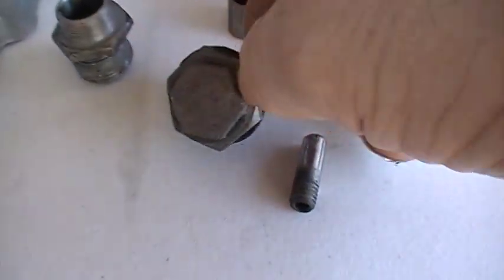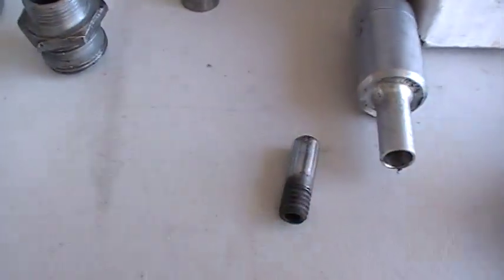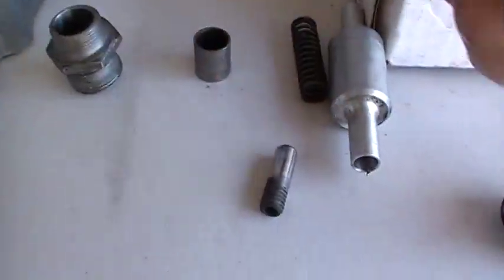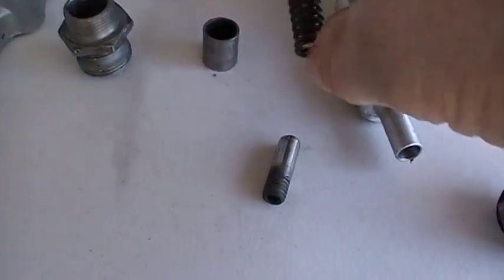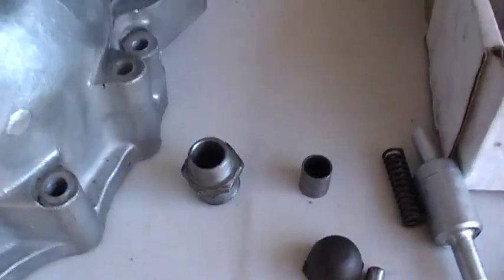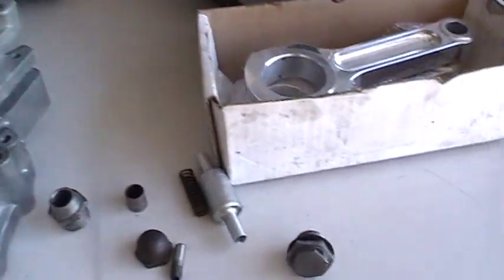And then I'd go down here and I'd use the Triumph pressure relief valve. This is the standard one, it just has a little ball on a spring, which is next to useless. The Triumph uses a piston, it uses springs, which you can change quite a bit, and the cap on top, and all the threads and everything's the same, so it's easy to use and easy to do.